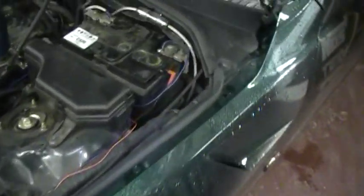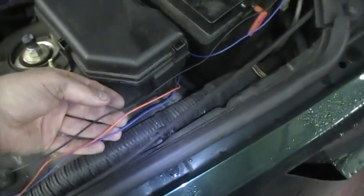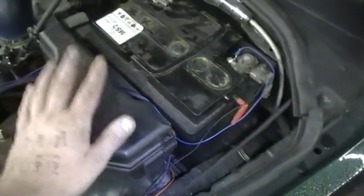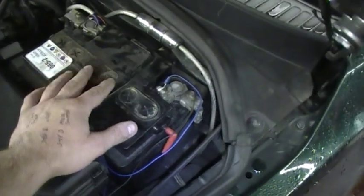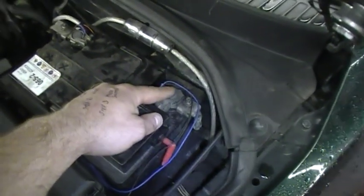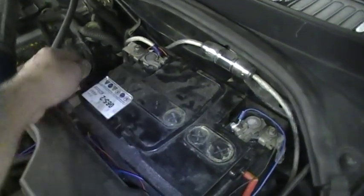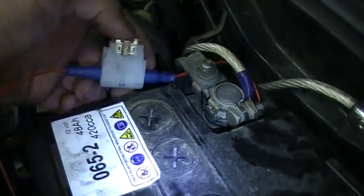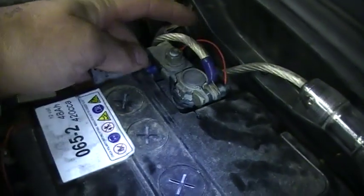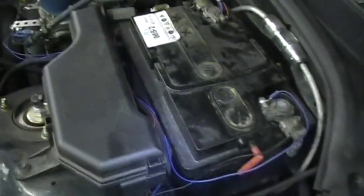Okay, and the wires come down here, and like I say, you've got only 3 wires. You've got red and black, which obviously go directly to the battery. Don't fit them into your fuse box, don't wire them into your headlights, just fit them directly to your battery. Black wire goes to the negative, or the earth, and red wire goes to the positive side of the battery. Now with the kit you also receive obviously the fuse, and please remember to fit this fuse. But you'll notice the Saber hasn't got any switches. It's obviously wired directly to the battery, which means if I press the micro switch it will sound.